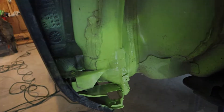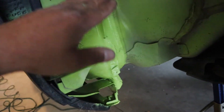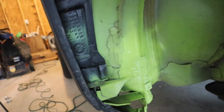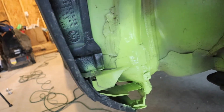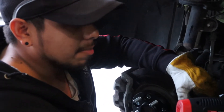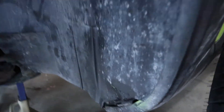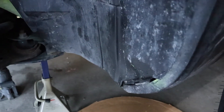Anyways, painted everything up. The last step is to put the wheel back in and actually use a heat gun to warm it up to kind of warp it to fit this new shape. Otherwise the tire is going to be rubbing on the plastic. You could always just cut the plastic, but if we can warm it up and warp it to the side we want, we'll do that first. This is the part of the job that takes the most patience — you've got to wait for the plastic to warm up. After applying the heat gun to the plastic trim here for a little bit, I was able to warp it to sit back. It should no longer hit any plastic when we put the tire on. Last step: do the same thing on the other side and we should be golden.